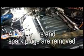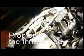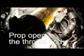Now we have our car prepped for the compression test. Bank one and bank two both have all the coil packs out. We have a battery charger on there to keep the battery with plenty of juice for starting — you don't want to lose amperage while you're doing this. Also make sure your motor can get air, so we put a box wrench in there with a screwdriver through it so it doesn't get sucked up into the motor.